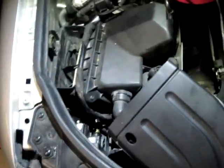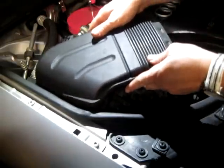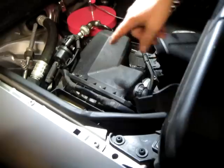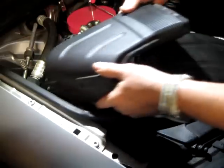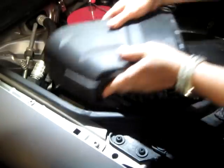Locate the hole. Oh, let's get the light in there. So now the headlight assembly's back on, all straight. Just need to get the air intake housing back on and relocated. So for this, you just slot in fairly easily. You've got to locate this tab here, over here, into the sensor housing. That's probably better done first, and then just slot this down in.